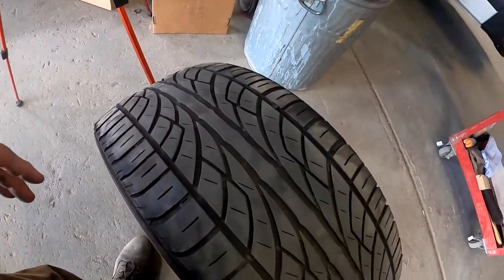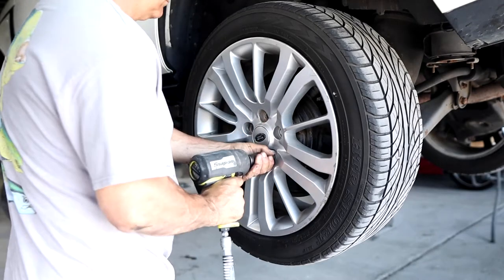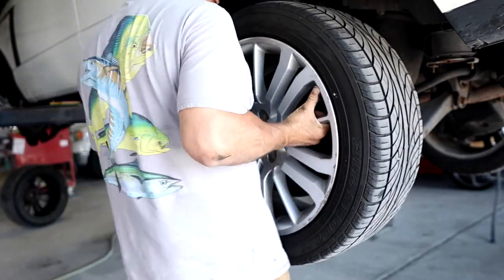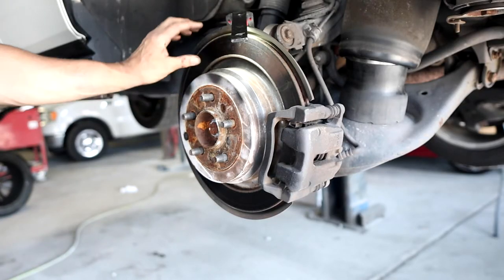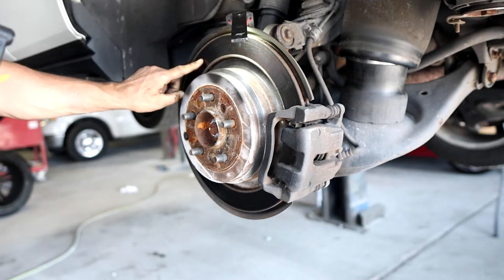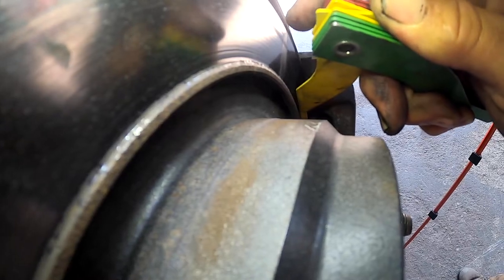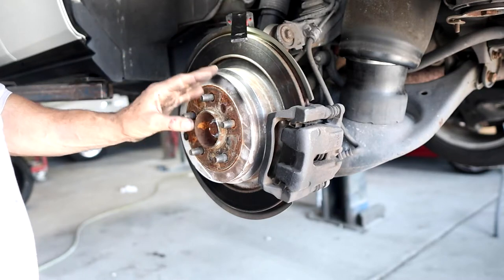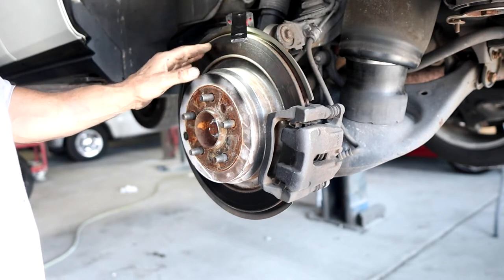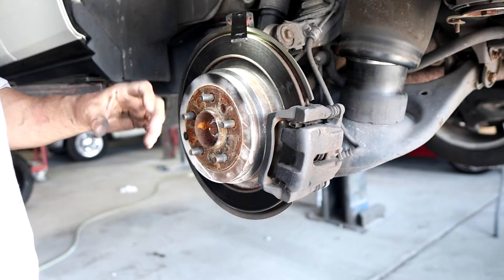Let's check the back brakes and see what we come up with. Looking at the rear brakes, the rotors are definitely worn out — they're out of round, and there are some bad spots all the way around. Looking at the rear pads, they're sitting at about 5 thirty-seconds, so they're still within specs and still have some life on them. I'm going to recommend rear rotors and pads — you never put one on without the other. The noise is coming from the rotors; they're so out of round that the brake pads aren't seating on them correctly, and that is the noise she's hearing.